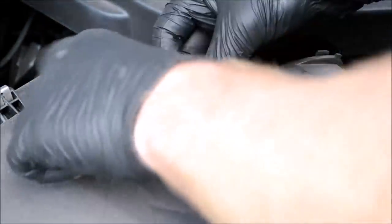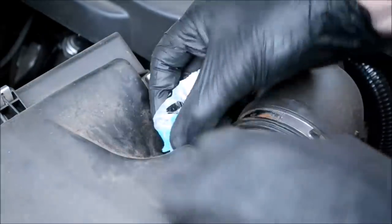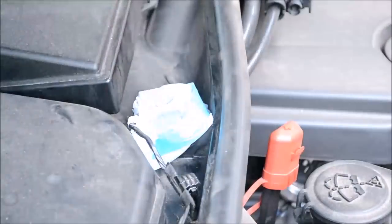One last bit of advice before jumping in with the pressure washer: don't get too close to any areas of the engine bay. Drop the pressure settings on your machine if possible and use common sense when operating. Use the pressure washer at a distance because we'll be letting our chosen products and brushes do the hard work.